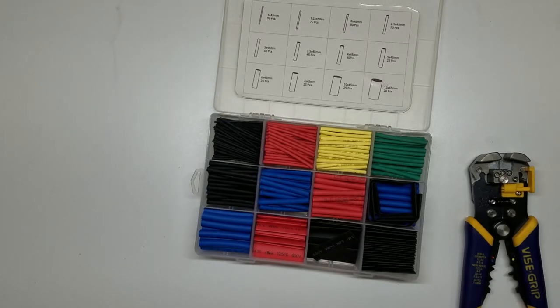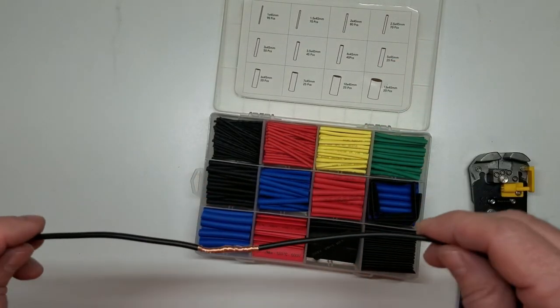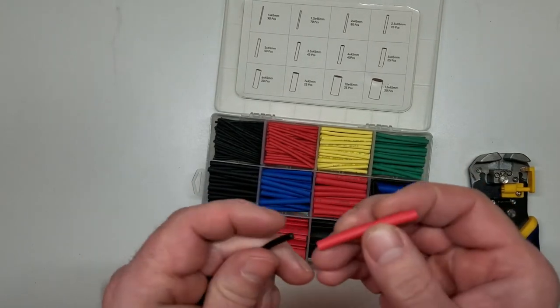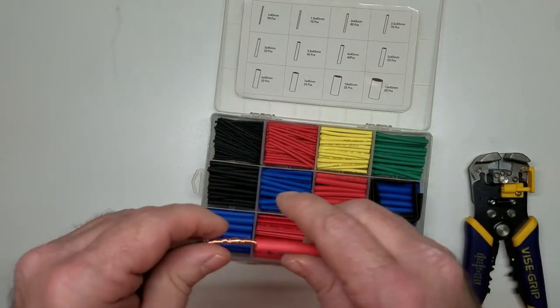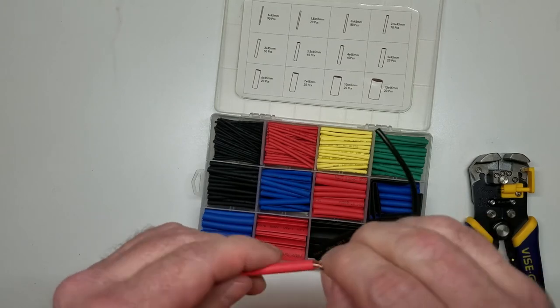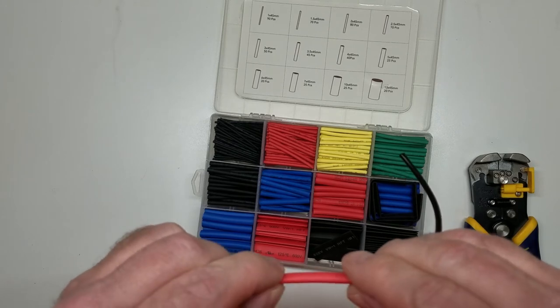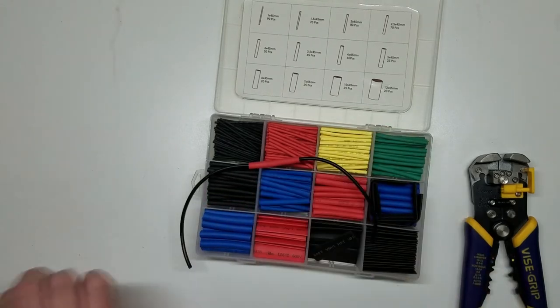So what wire protection are we using this time? That's right, good old-fashioned heat shrink. Great stuff right here. Got our splice already set up. And we see this is a 16 gauge wire, so we're going to use this color right here. We'll come over top of the wire, bring it down over top for a splice. And what you want to do is, okay, right there's my edge of the insulation. You can bring it back there towards the edge of the insulation, kind of center it. Boom, that's where we're going to shrink it. Oh, let me get my heat gun.